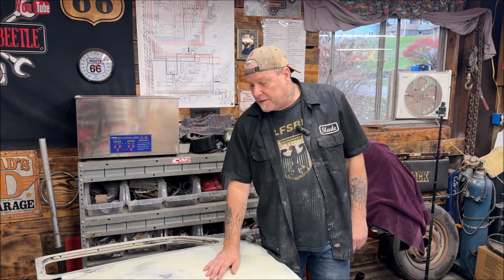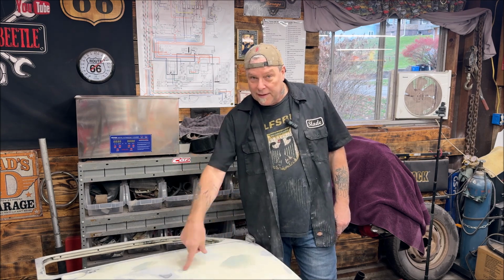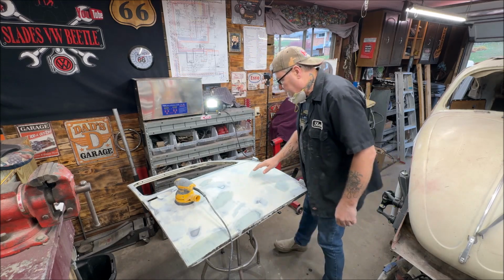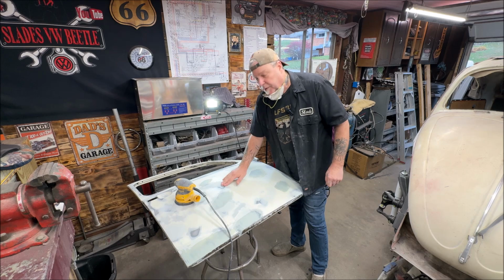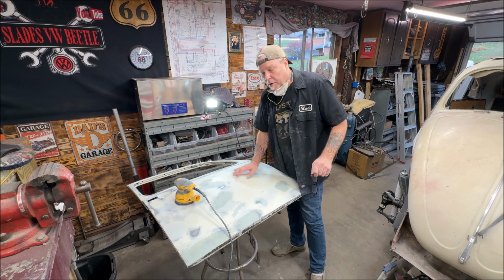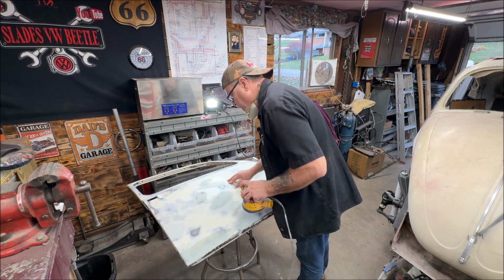All right, let's go ahead and get this sanded down. I'm going to hit this with 180, I believe. I'll tell you in a second, because I want to go with a little lighter grit. This might be the finished part here. So, time for that. Okay, I'm not going to put my gloves on today, but you wear yours. You shouldn't be getting stuff in your skin. I need to feel everything to make sure it's smooth, and with the gloves, it's hard sometimes. So let's get this done so we can warm our primer up, wipe this down, and get it in primer and move on. So I got 120 on here is what I have. So we're going to start with that, and I'll speed the film up.